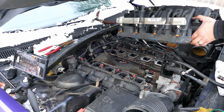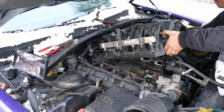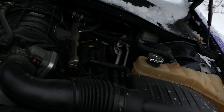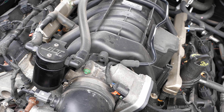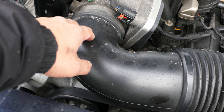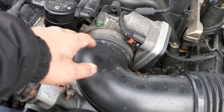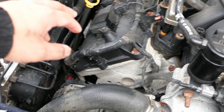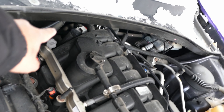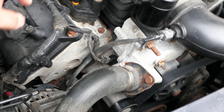What's up everyone, today in this episode we're replacing the 5.7 liter Hemi intake manifold gaskets on a 2011 Chrysler 300C all-wheel drive. It's like negative five so we're gonna do this quick. You gotta disconnect everything — a bunch of 8 mils, 10 mils, and possibly a 13 mil, a flathead to remove this. We're gonna get this out of the way so that we can clean it. Disconnect your injectors.